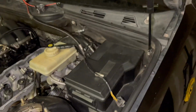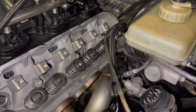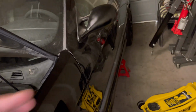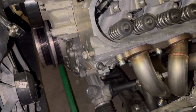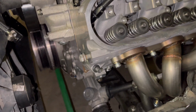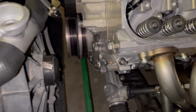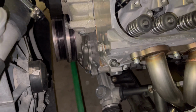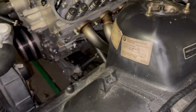And then, not the drive shaft, the transmission is on a poly mount, okay? And then my differential is on 95A poly. So it naturally is gonna wanna be a very harsh ride. So what I do is I always go ATI balancer because that eats up, in my experience, like 75% of vibrations. All right, down there 80, 85. It all but eliminates it, okay?